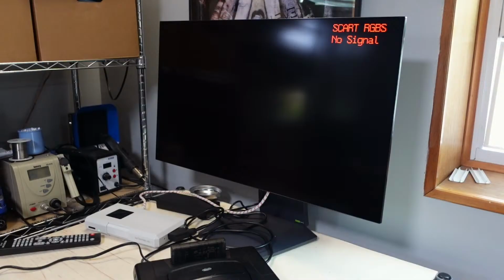Robert, the cartridge slot on both of my Saturns are too temperamental to use a Saroo. Sometimes they just won't read carts, and no one in the modding restoration community seems to repair them. Index card. Take an index card, fold it in half, jam it back there, see what happens. If it's not enough, fold it into thirds. That's how this Saturn ran for the past 15 years. And when that's in there, it works perfect.